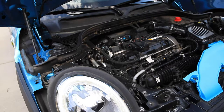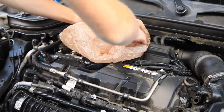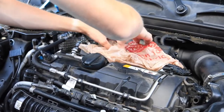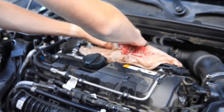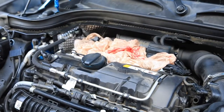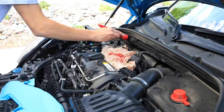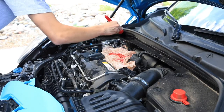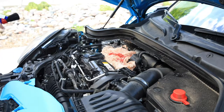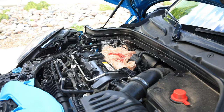I'm also going to grab a bag and tape that over any of the electrical bits over here. That should stay on since I'm not hitting it with high pressure — even though I've got my pressure washer, I'm going to be hitting it with low pressure. I've got this brush to agitate anything that's caked on, and any sort of agitation will help loosen it. I'm going to start with a 15 degree tip with low pressure.